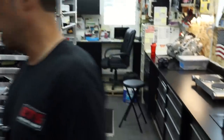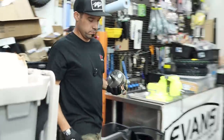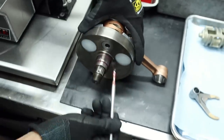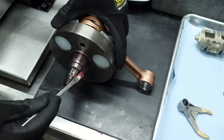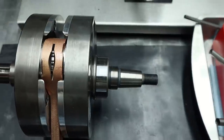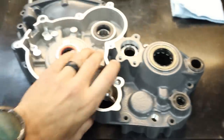Okay. And then I'll get the crankshaft out of ye olde fridge. Got the fridge. Everything gets the love around here. Need to. Just makes life easier. This is the side that's going into the bearing we are heating currently, right? Correct. So you guys can see the other side. That inner race is already on the crank that goes inside this sucker.